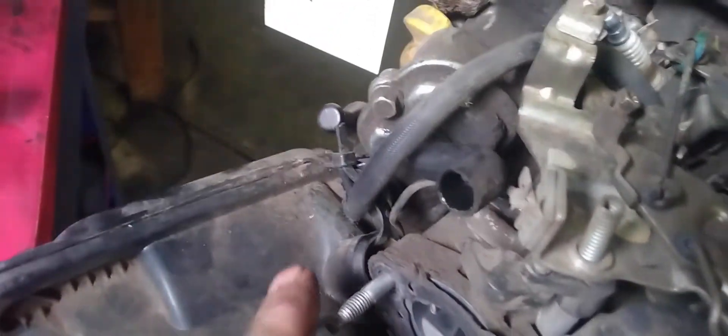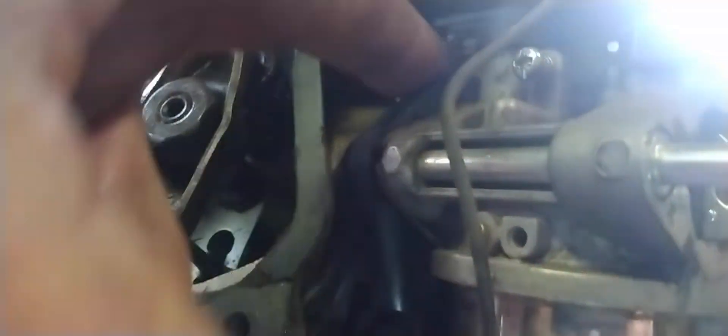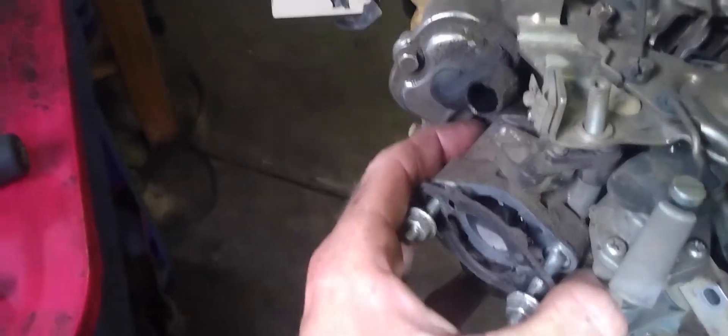That's not actually done right — somebody did a coil on this before. That's actually supposed to run differently. Now if you look behind your carburetor, here's a carburetor plate — this big plastic plate — and see that groove? That's where that ignition coil wire is supposed to run out of and up over here. I don't know why they had it running to the top, but this is the wrong way. So what we need to do is get this carburetor to pull forward so that we're able to get behind that plate and put our wire in correctly.